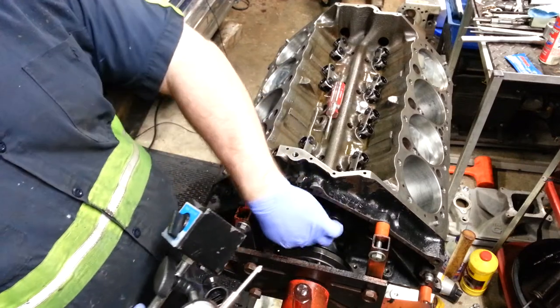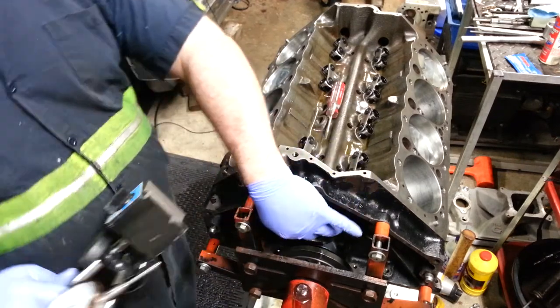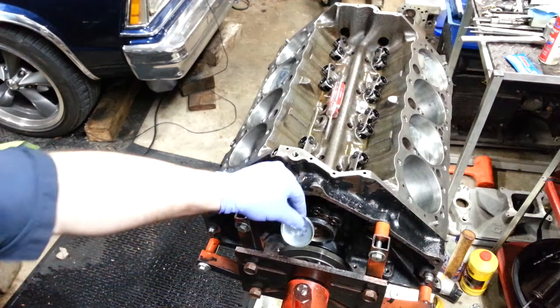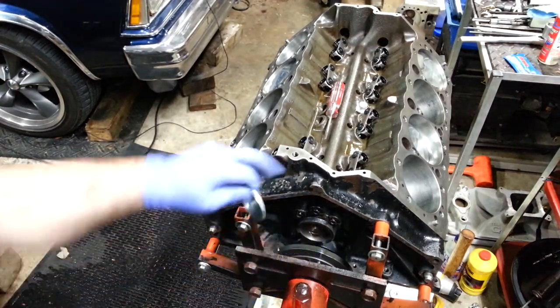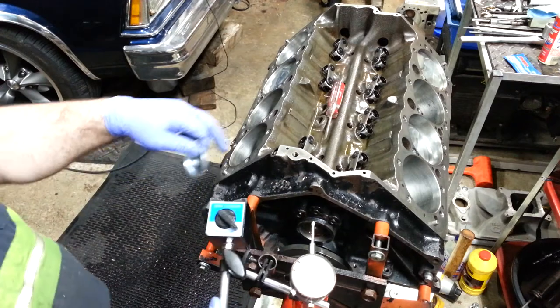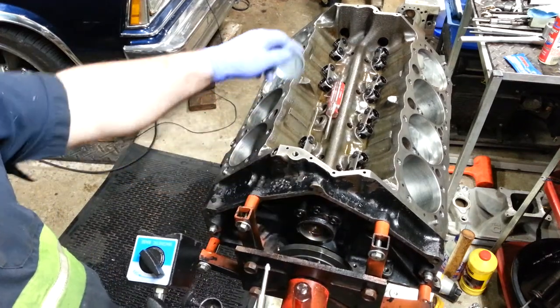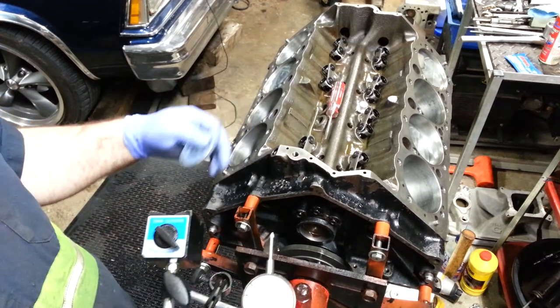But it's on the back of the cam, so don't put the steel plug that goes in there when you're doing your build. If you can, you put this in last, but you can put the actual indicator on there, and then as you pull it back and forth and it presses against the button into the plate, you'll have an actual real measurement.